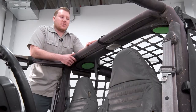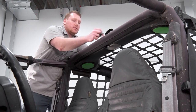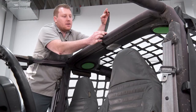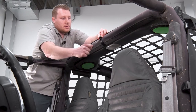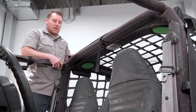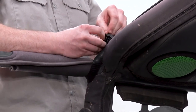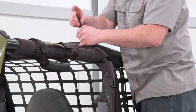Next, we're going to start with the straps up top. We're going to go in between the sound bar and around the roll bar, drop our strap through, then go back to our buckle — through the back slot and then in through and down the front slot. Once you have that in, you can pull it a little tight. For the side ones, you have a buckle up top and a strap on the side — go around the roll bar, through the buckle, and down back through the front slot. Pull that tight and do the same thing on the other side.